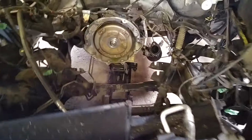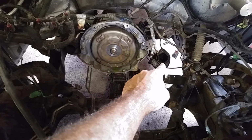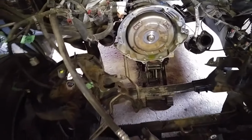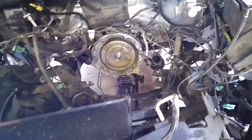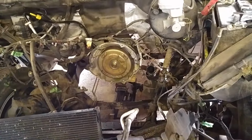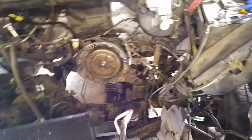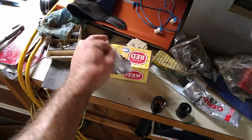I took the exhaust manifolds off, but I think you can just leave them on and undo the two mid pipes there. I think they were 14 mils. Pretty much the wiring harness, there's nothing sneaky. Remember to label all your connectors. It may seem obvious to you now, but when you go to put this thing back together, maybe it's a week, maybe it's 6 months, you won't remember. Also label all of your bolts. I put them in little bags and write up little labels for them.